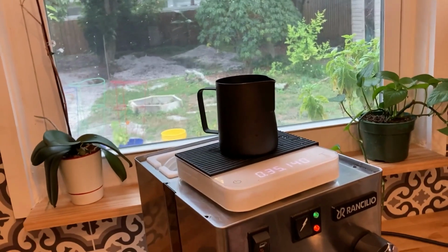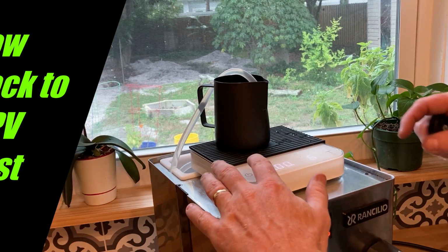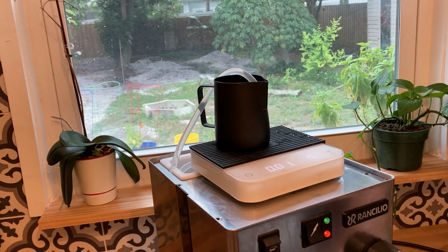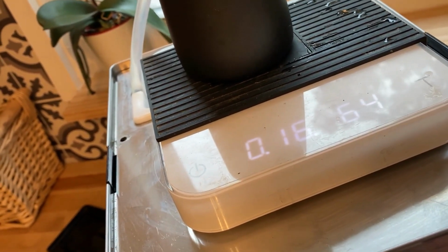And I bet now when I go to test that, it's going to work just fine. So I can go back up here, turn on your hot water. That water comes to the top, it's coming through. Turn on your timer and go. There we go. Again, 130 for every 30 seconds. So I'm at 10 seconds right now, 12 seconds. And I want 130. Should be dead on.